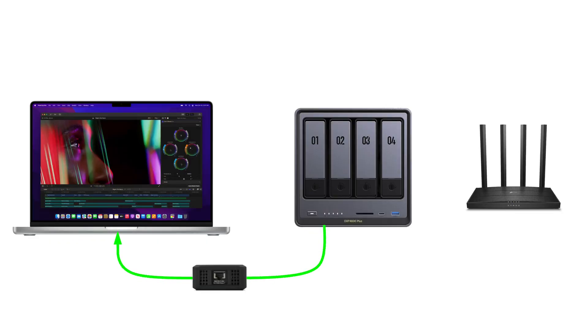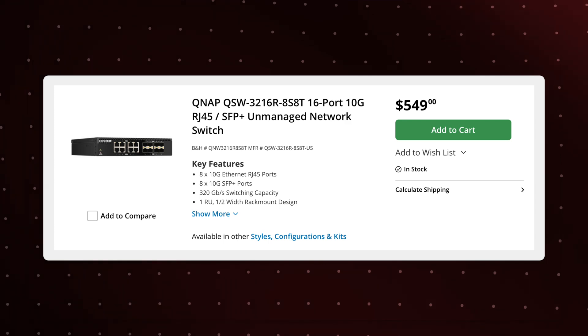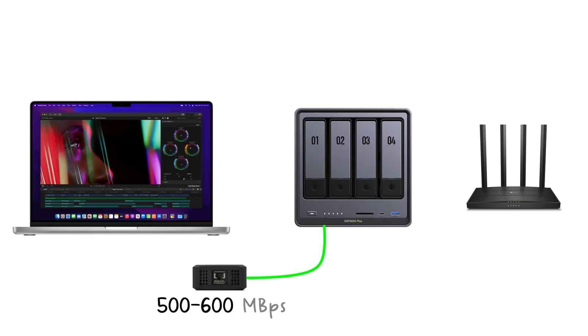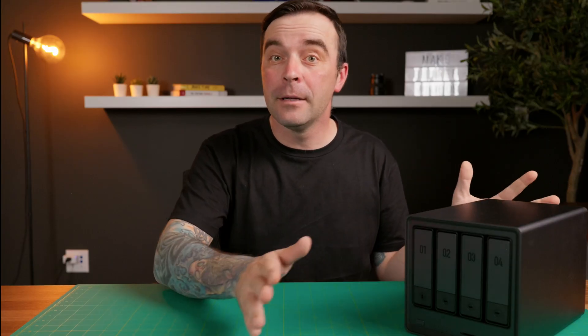With this connection method, our speeds will be quite a bit higher — I'm getting about 500 to 600 megabytes per second upload speeds, that's 1 gigabyte of data in just a couple seconds. The problem with this method is our NAS is only connected to one computer and can't be accessed remotely or by other machines on our network. To get the most benefit from this NAS, we need to combine the two connection methods. Normally, you'd have to get a 10 gigabit ethernet switch, which is not cheap. But the Ugreen 4800 Plus comes with two ethernet ports which can be bridged — it has a built-in ethernet switch. We can connect the 10 gig port to our computer and the 2.5 gig port to our internet router, giving us maximum speeds locally while still having remote access. With our drives in and everything connected, we can plug our NAS in, turn it on, and set everything up.